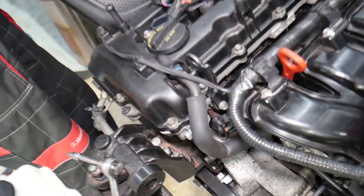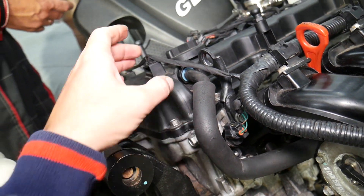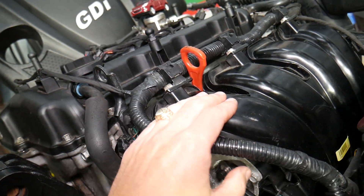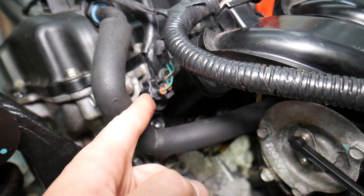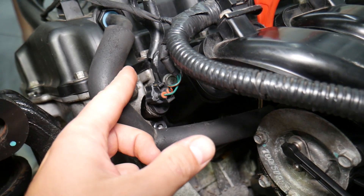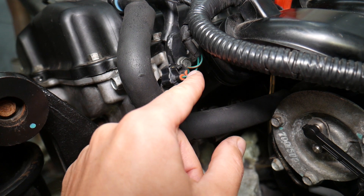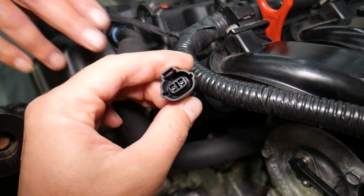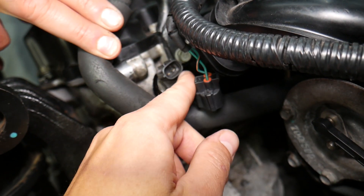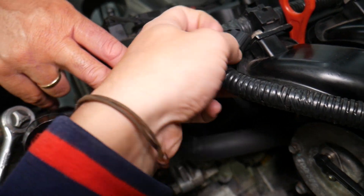If you have any of these codes, you need to identify where the intake camshaft is located — that's usually next to the intake manifold — and find the variable timing solenoid. First thing to check: inspect the connector right here, make sure the wires are plugged in and not pulled out. Remove the connector itself and inspect everything — make sure nothing is bent, corroded, covered with oil, or wet, because that can affect it.